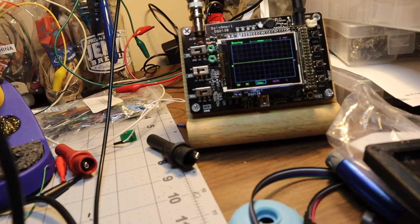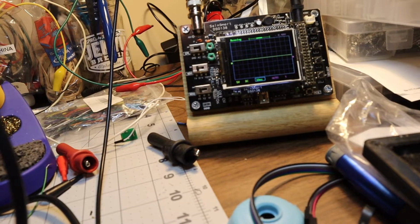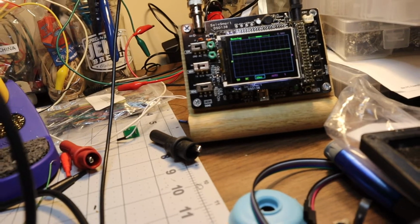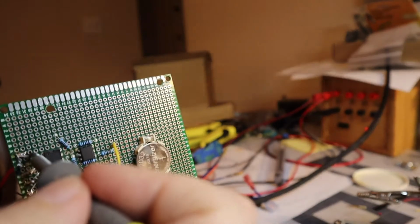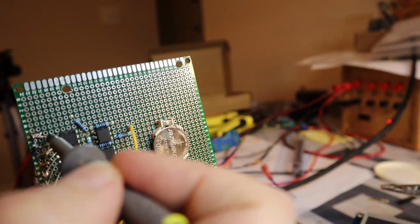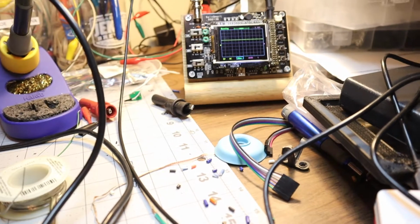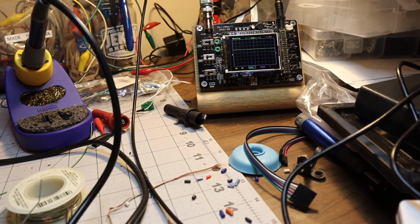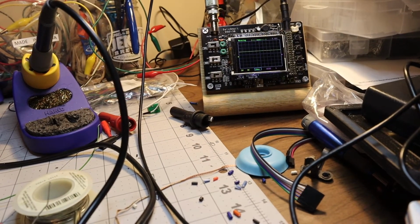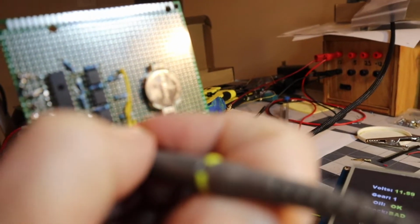Right, that's my first gear. That's neutral. See how it jumps. That's first gear, that's neutral. First gear, neutral. That's the first gear, nothing. We're going to neutral, we have 5 volts. Right, see, 5 volts. Same thing with the shock selector.